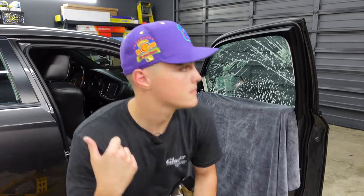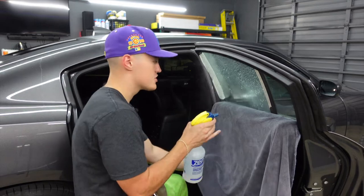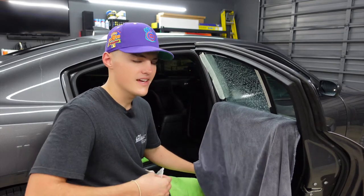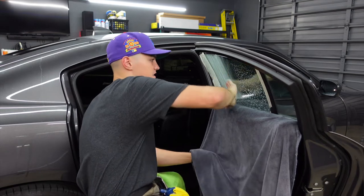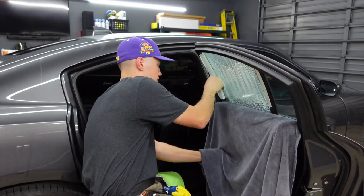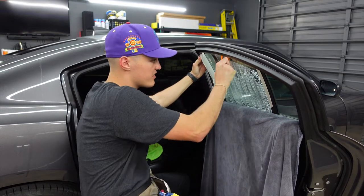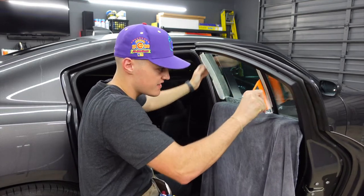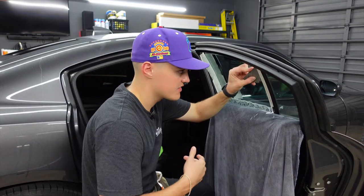For the most part, this window is clean. So what we're going to do now is take our slip solution, which is just baby shampoo and water — I use 15 pumps of baby shampoo and water from the faucet. We're going to take our 3M scrub pad that you can order off of Amazon and give the window a quick scrub to make sure it's clean for the new application of 5% window tint. We're then going to wipe our top edge with our microfiber cloth. There's a bunch of dirt that sits up on that top edge, so it's always very important that you wipe that down.